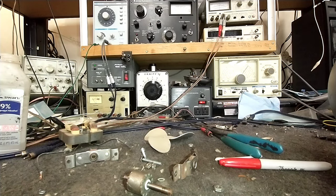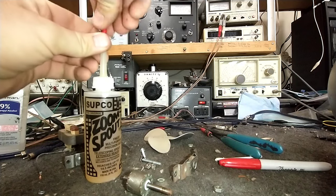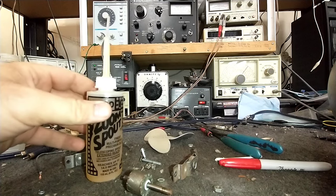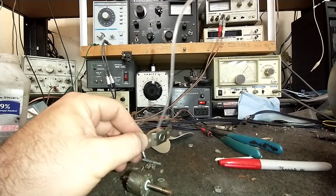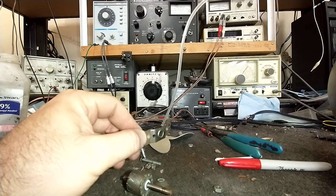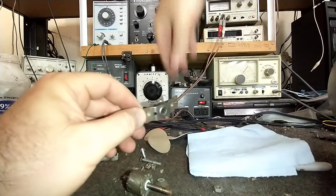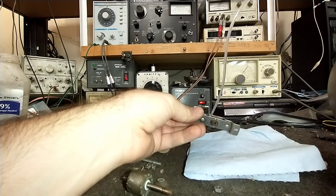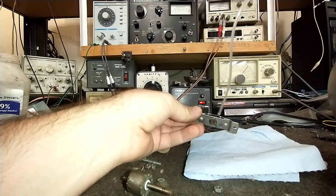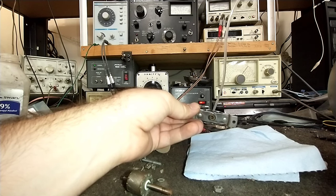Let me go get the infamous zoom spout and start oiling this stuff up. That's what we're going to use today — turbine oil with a little telescopic extender. I'm going to saturate this oil wick first. Let me get a paper towel underneath in case I start making a mess. I'm just saturating this; I don't want to have to open it for a while. Let it soak it up — and it sure is doing that. You know that it's saturated when it starts to drip.